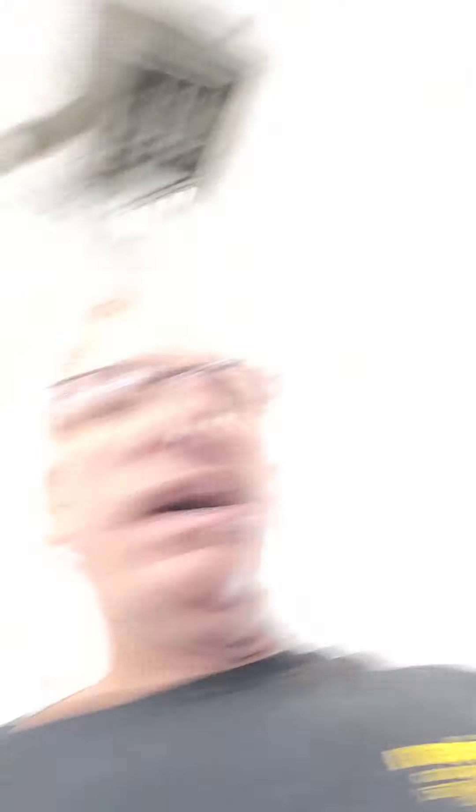This car is just going to run. I like to let it run until I don't see any more air bubbles, all the hoses are hot, the cooling fan has cycled on and off, and it has not overheated. This is filling your cooling system for dummies — how about that? Thanks for watching.